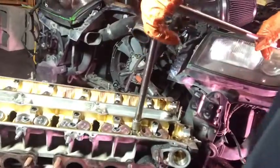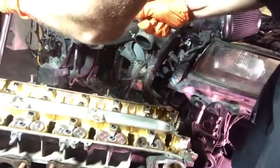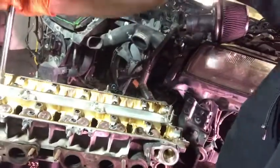And Drift fans, you know that you want to release the head in reverse order from the way that you put it on. And that is so you don't warp the head, especially when you have an aluminum head, because they are finicky.